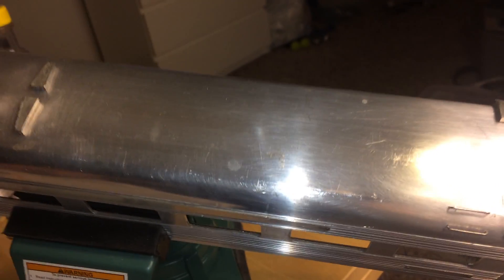This is going to be kind of hard holding the camera and doing this, but you can see we got a big blemish right there, a big scratch. So I'm taking a piece of 800 grit wet-dry sandpaper and we're going to work that area and try to remove that big scratch. Put a little bit of dish liquid in the water just to keep the paper moving — and you see there, that big gouge is gone.